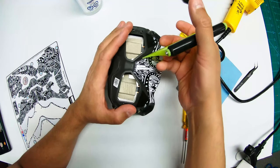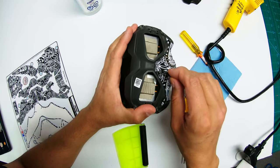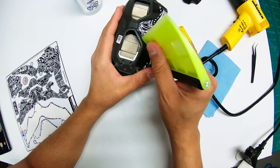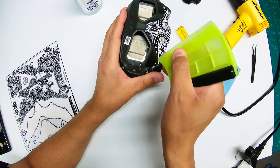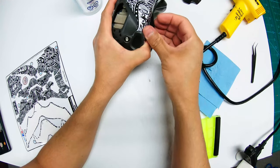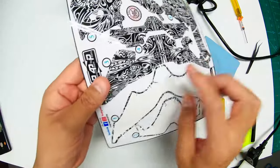Tuck in the edges. The top edge here overlaps, so when you heat it up it might curl. You can simply take a pick, pull it out, press it down, and overlap it — it doesn't matter whether the top or bottom overlaps as long as it's not bunched up. It looks really good once overlapped with the faceplate on. If you make a mistake, gently pull the sticker off — wait for it to cool first so you don't stretch it, then have another go.